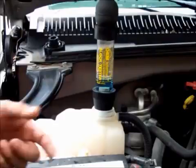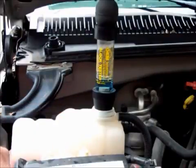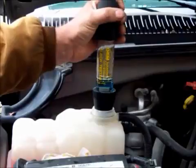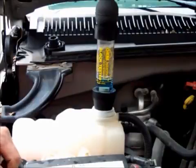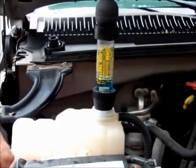If you disable the spark, it won't burn any of the gases in the combustion chamber, and unburned gas will not set this tester off. It's only combustion gas that will set the tester off. So that's just one way of knowing whether you have to tear both sides of the motor down or not. A lot of people prefer to go ahead and tear both sides down and replace both, but it depends on your situation.